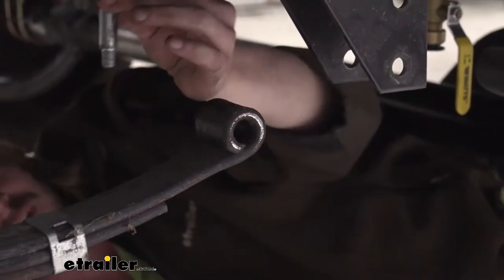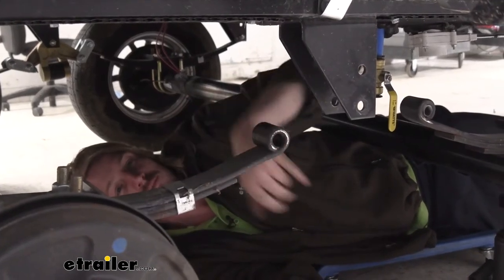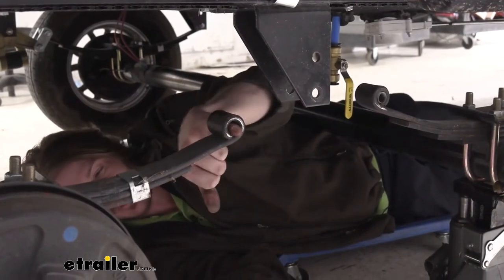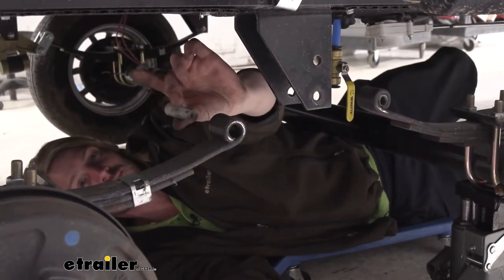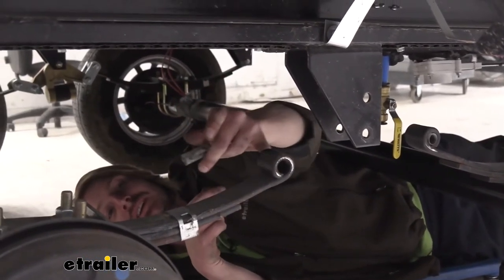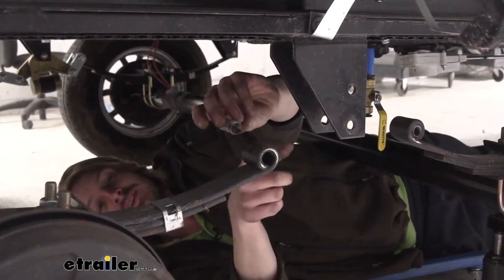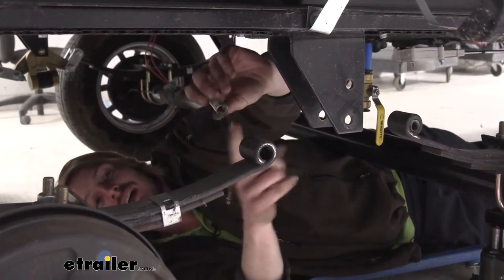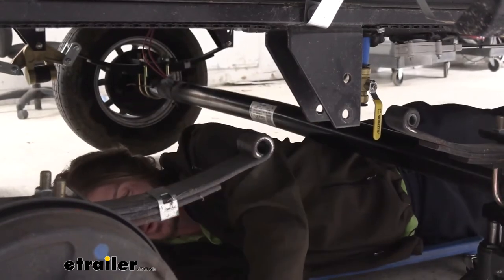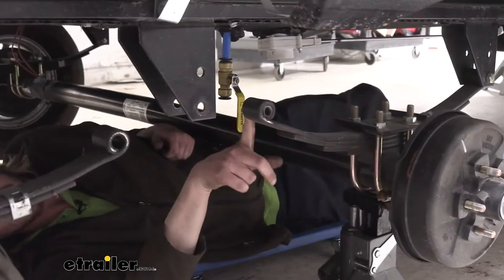We got that one removed. Still save your bolt — we can still use it for installation of the new bushing. I'm just doing a quick check to see if there was any damage. This is a fairly new trailer, so it's unlikely since the bushing was still intact. It's when bushings get a split down them and they're no longer round that you really need to inspect your eyelet, because that means the bolt wasn't being held snug and was allowed play, likely wallowing out the hole. Everything seems fine here, so we'll grab our bushings and get those installed. We'll repeat on the other eyelet too.